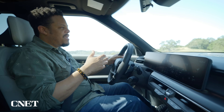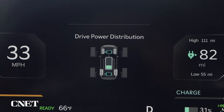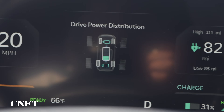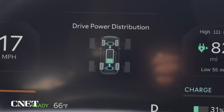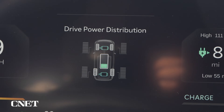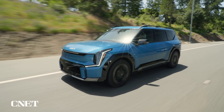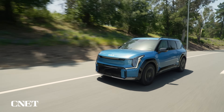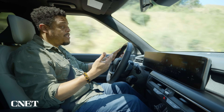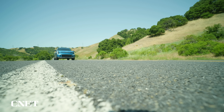In those situations, the magnetic fields turning in the motor add a resistive force which causes the vehicle to slow down, and that turns the electric motor into an electric generator, and energy starts to flow out of it. That's how electric cars use regenerative braking to increase their range and improve efficiency, recapturing energy every time you slow down. You're never going to get all of the energy back — it's not a perpetual motion machine. There will be losses due to friction and other factors, but extra range is extra range, and it's one of the ways this GT Line spec gets to its 270-mile EPA estimate.